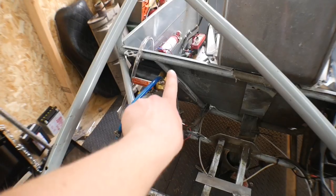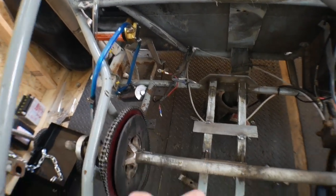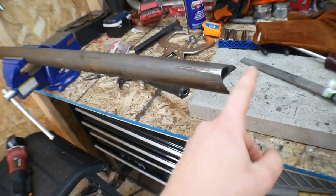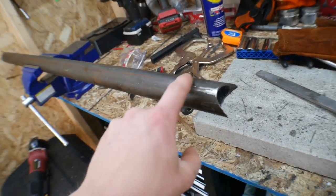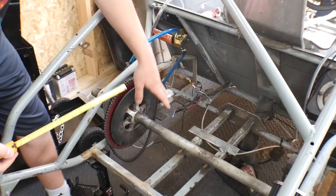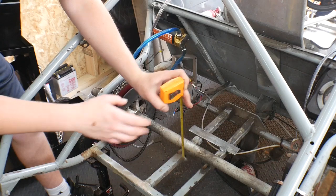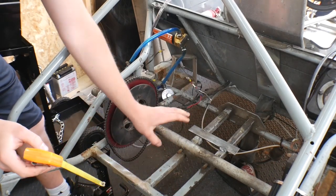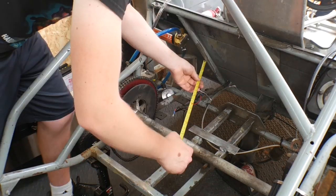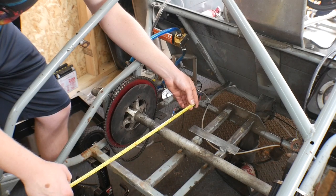Now I'm going to line it up with that pipe, measure how far out I want it to come diagonally, cut the slant, and add the straight section from there. The hole dozer went right through the pipe because I need to cut the edges — it's a little thinner at that point but went through like butter. I want this piping as low as possible — at most four inches from the bottom of the frame. I need to cut off roughly a foot, make the flat slant, and then it would come back about another 20 inches.